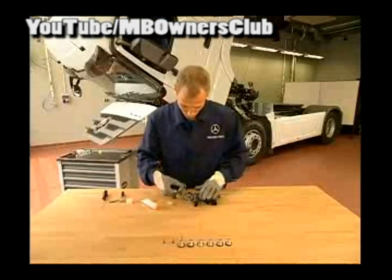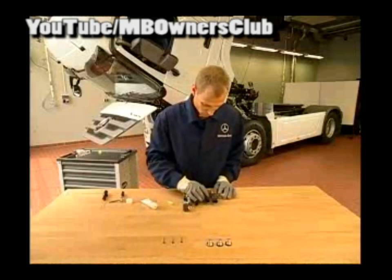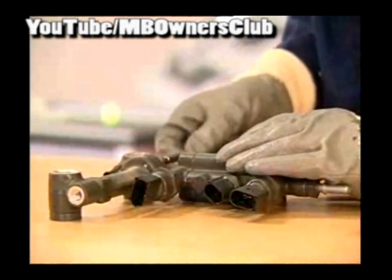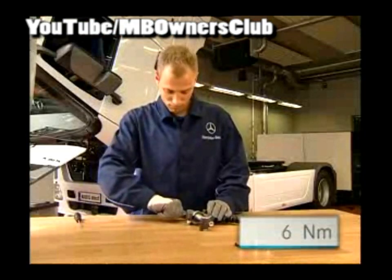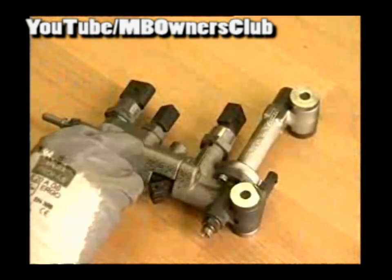Then place the new diffuser in the air pressure line. In the next step, mount the air pressure line on the metering housing. Check that all parts fit flush. Use the three lower decoupling bushes to level out the metering unit. Once the metering unit is level, tighten the three screws slightly — the metering unit is only sealed if the screws are positioned correctly. Finally, tighten all three screws with a torque of 6 Nm. Insert the remaining bushes, and now you can mount the metering unit on the vehicle again.